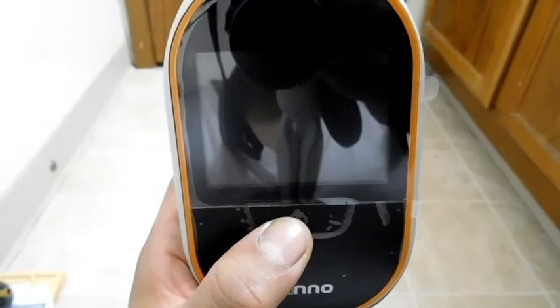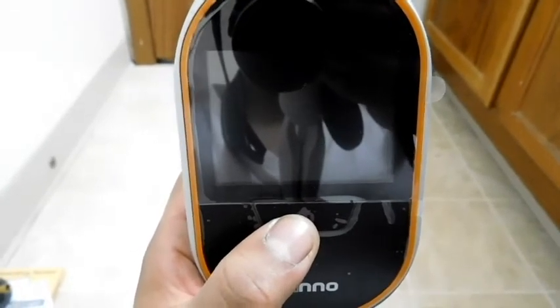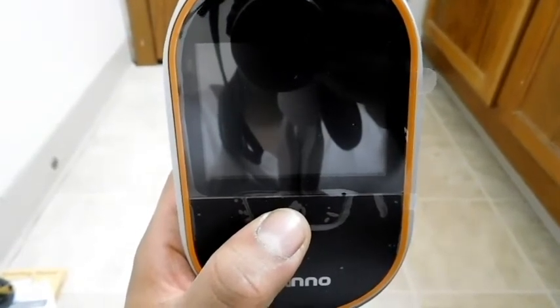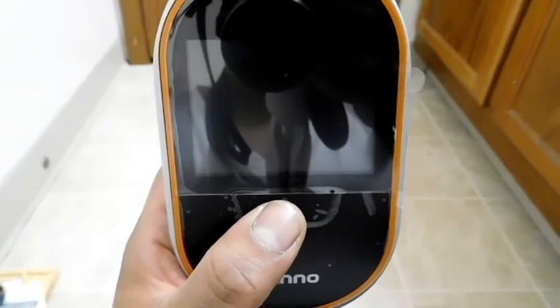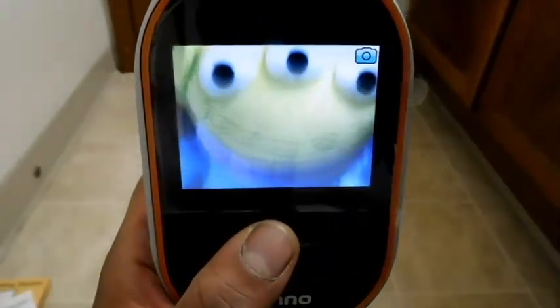Now, how does this thing actually attach to your door? Essentially, the lens comes in from the outside, and then you screw in the barrel assembly from the inside. That barrel and screw assembly serves as the hanger. Then when you put on the unit, it's a turn-to-lock style, and there's a little screw here to tighten it so it doesn't rotate while it's on your door. So I've got the batteries installed, I put in the SD card, installed the knock sensor, and with the main unit powered up — if I push the button here — it does in fact work.